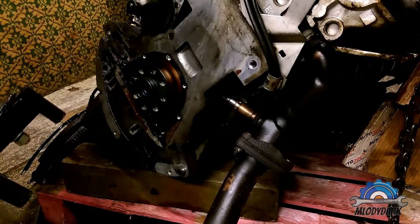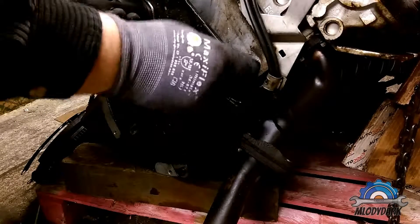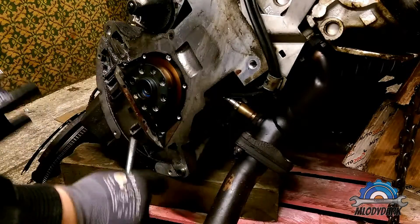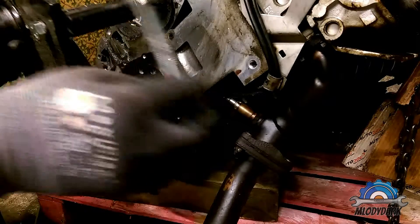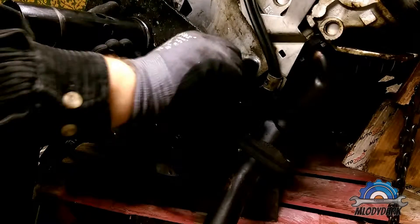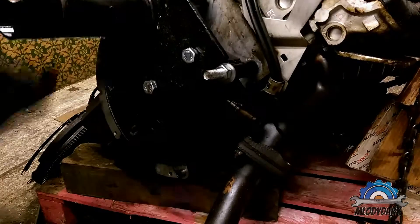Welcome back. In this video, I'll show you how to put an engine on the stand. The stand comes with a bracket for your engine, but they don't supply the bolts. This engine has four main holes from your transmission and that's an M12 size bolt, which I bought at any hardware store. I got two long rods, cut them into pieces, and matched the same nut size to the screw.